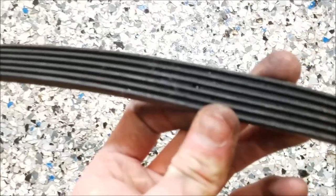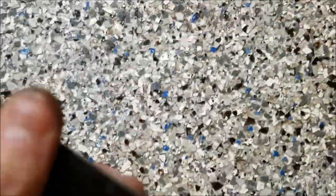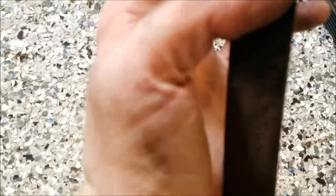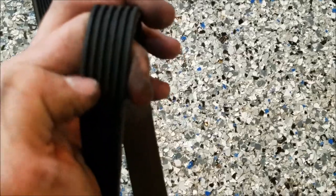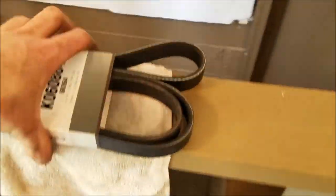There it is. Now yours might be worse. Look at this — you can see the other side of the belt. It was curved around on the alternator, which was probably causing squeaking — that's not acceptable. If there are more than three full cracks within about an inch, you should replace it. I'm going to very carefully go through the same process and put the new one on. It's back in that little pocket right there and I'm gonna jack it up fully so they're making full contact.